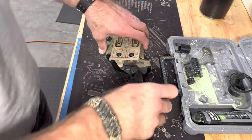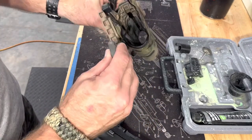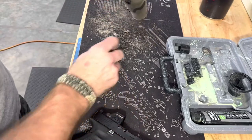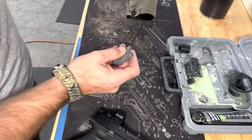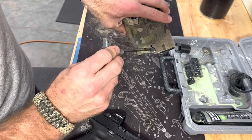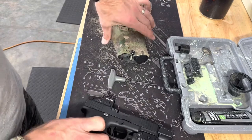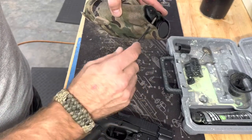I got the dremel work done. I had to dremel out in here — I kind of turned it sideways. It's smooth in there now. I took some sandpaper and just hand-sanded it in there. Down in here, I got it dremeled out. I actually had to reposition this hole further down because it's got this little bull nose on it here under it that was kind of blocking half the channel. So I just moved it down and put everything back together. Let me finish tightening it just to make sure we're good.